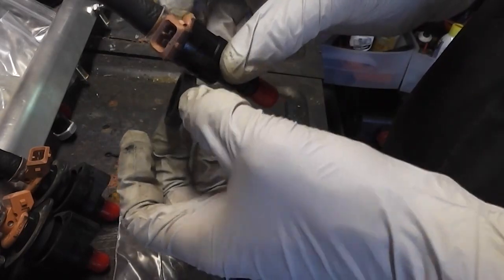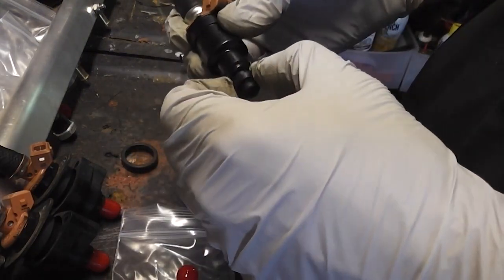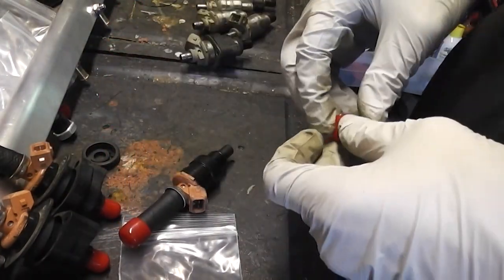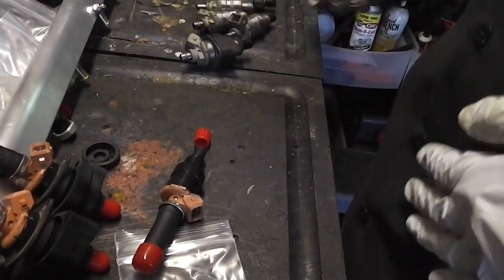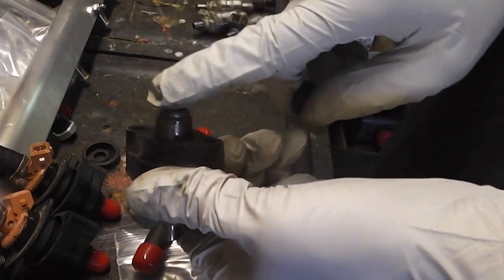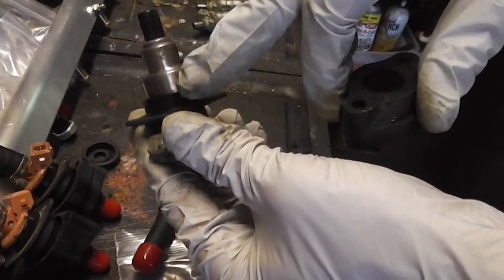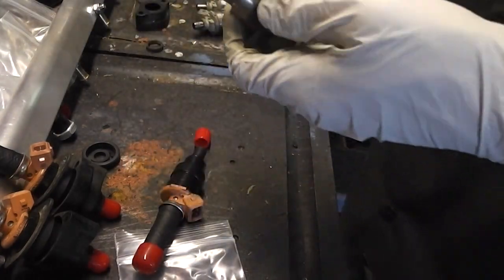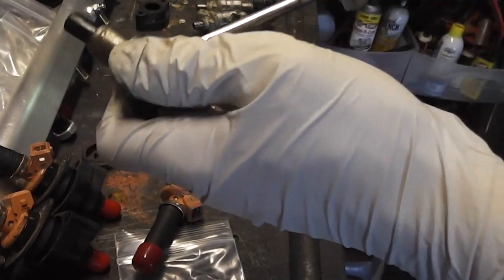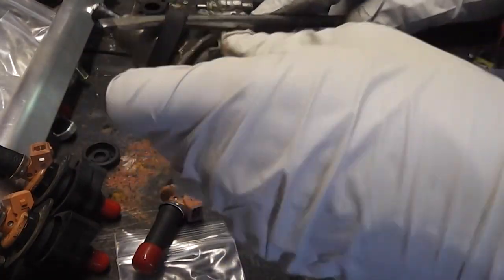We have a new O-ring for the mount, and a new O-ring fitting that goes into the intake manifold. It doesn't come with the mounting hardware, so we're going to have to reuse that from the old injectors. We remove all the seals — the O-ring for the manifold has already been removed — then we remove this mount and pry out the compression O-ring fitting with a screwdriver.